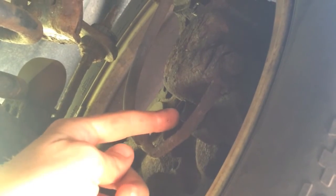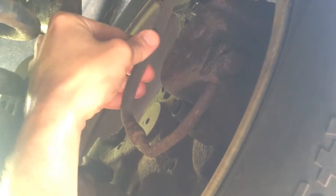Make sure you use brake grease specifically because it is specifically formulated for brakes. It's not going to pick up as much dirt, and it's not going to dry out like other greases may.